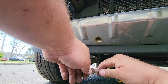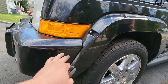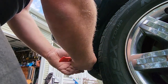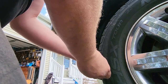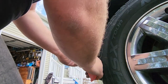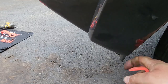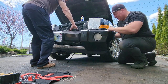Coming around on the driver's side — I'm not gonna use this fender flare because it's got some scratches. I'm gonna reuse the other one, so I'm gonna detach the fender flare from the bumper only. I'm having some trouble reaching this, so we're going to move the wheel in — that'll give us a bunch of clearance. Got it! Rob's gonna hold the bumper and I'm gonna unplug the fog lights. Sweet victory!